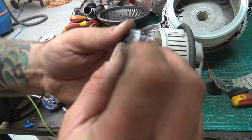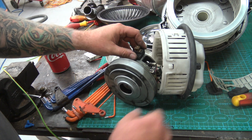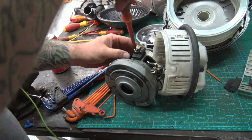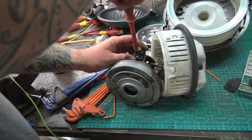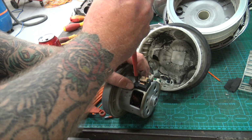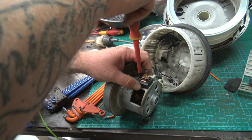The wear seems alright, nice even wear, still good spring, so it's not as easy as just blaming the brushes just yet. This could be like the whippersnipper and we may have lost ourselves a turn, so it could be for the graveyard, this thing. We'll check the other side. I assume they wore evenly. Same quality brushes, same factory, rah rah rah.